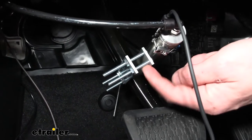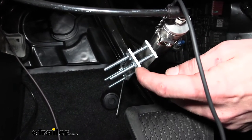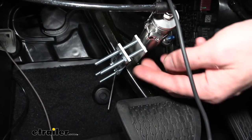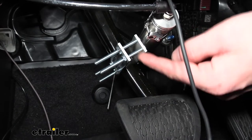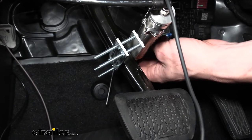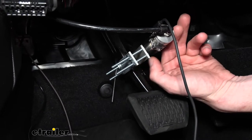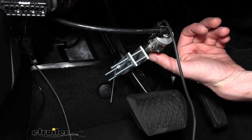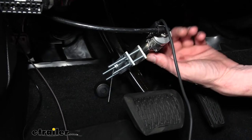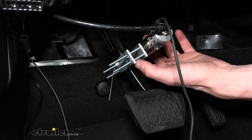The bolts you see here are the secondary bolts from the kit — the pre-installed ones stop right at the end of the nut and it's too difficult to get the nuts installed on the bracket with those shorter bolts. So we removed the bracket using a number-three Allen on the two Allen screws on the back side, then removed the original hex-head bolts with an 8mm socket, threaded in the longer bolts from the kit, which tighten down with a flat-head screwdriver.